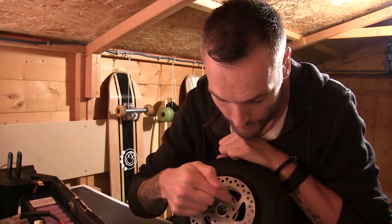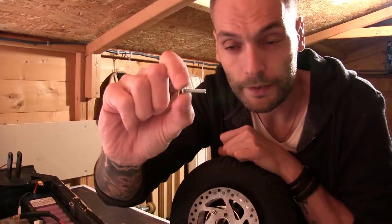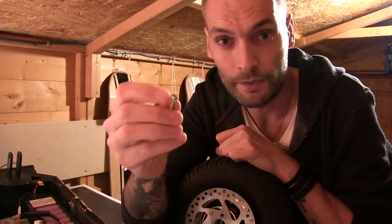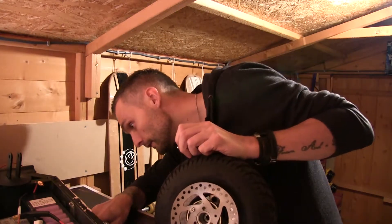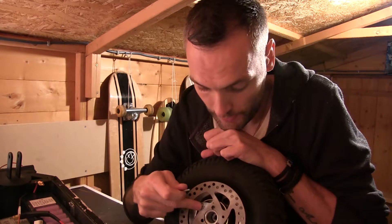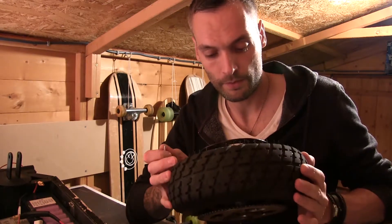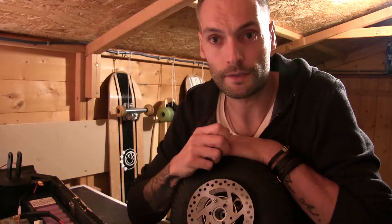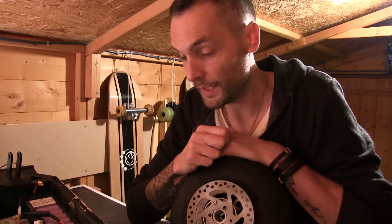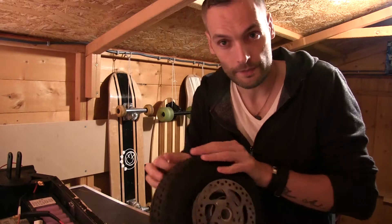What I've done is pre-drilled three holes - one there, one there, one there - and I'm using these little bolts. They're a Phillips screw one end and a bolt the other. You get your nut - I'll dig it out in a second to show you - and basically drill your holes, put that behind it, put your nut on top, tighten it as tight as you can, and it should never move. We've just got two more holes to drill, then the disc is on nice and smooth, then we can put the wheel on and figure out the bracket for the caliper.